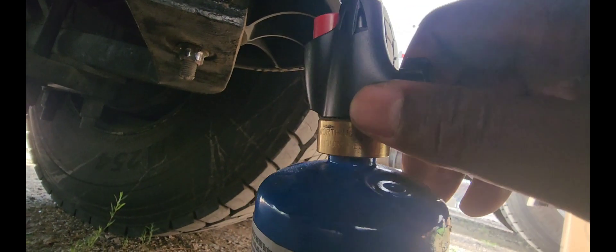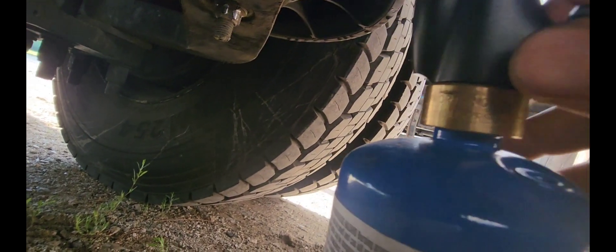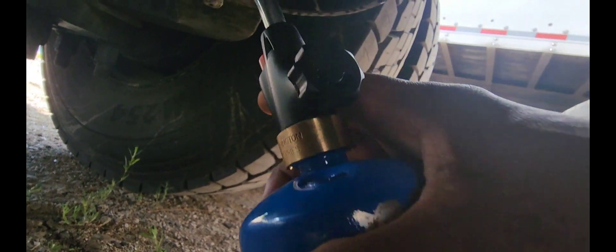So this is my propane over here. I'm going to heat it up a little bit so I'll be able to take it out. Because when it's rusty and you heat it up, it's going to burn the rust and you'll be able to take it out. Even if I spray the WD-40, it might not come out — you have to heat it up really good.